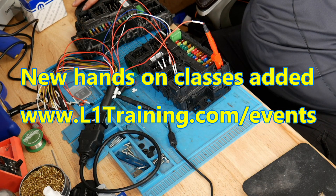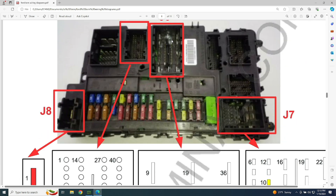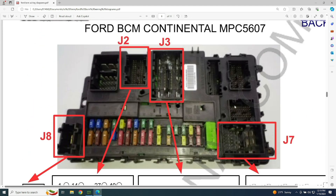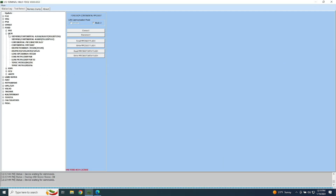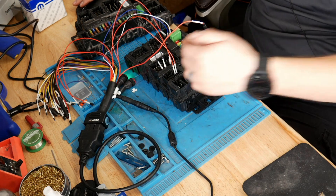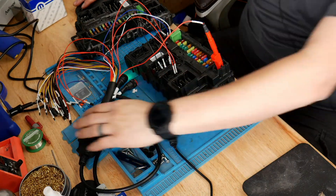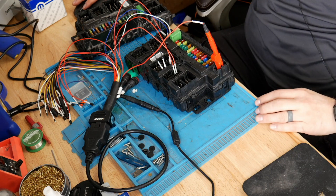I'll show you what we're dealing with. So using IO Terminal, I pulled up the instruction sheet. Adrian's was kind of crusty, but we're hooked up exactly as the instructions show here. Essentially we just open the tool up, go to BCM, go to MPC5607. We make sure everything is hooked up power and ground-wise as it's supposed to be, and make sure the ignition is turned on. We're using that little Go Diag cable here — there'll be a link to that tool in the description of the video and on the website.